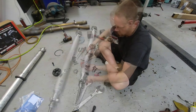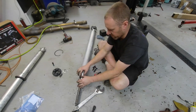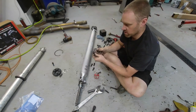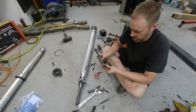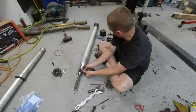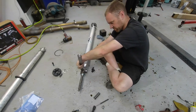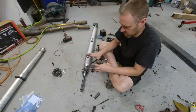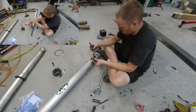I'm going to need a ratchet wrench setup. When you do this, you can't get a normal socket in here — you actually have to take the socket head off of the ratchet and just use the ratchet wrench with a drive. I took the part that holds the drive and punched it over with a punch. Now I'm just going to hook up this little ratchet wrench to tighten everything down. I can't really torque this to an actual torque spec, so the best way is to use a ratchet wrench plus an adjustable wrench on the other end to get enough torque to know it's tight enough.